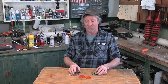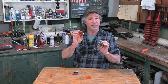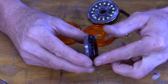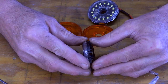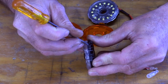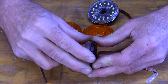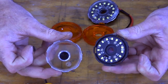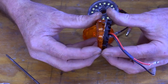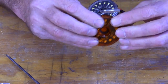The kit comes with KC LED lights with the optional amber lenses. The way that I find is easiest is to take two of these tabs, one with your thumb and one with your finger, and squeeze them. Then take a small screwdriver and get in between the lens and the case and pull them apart. The other lens goes back on the same way — line up those three tabs and snap it in place.